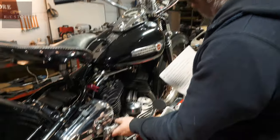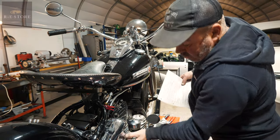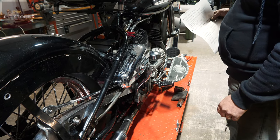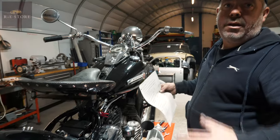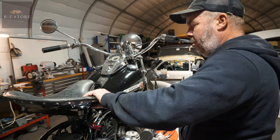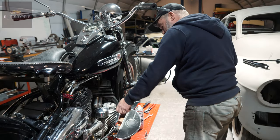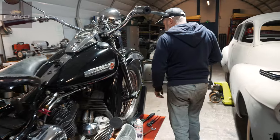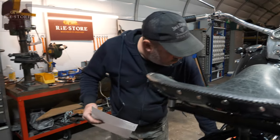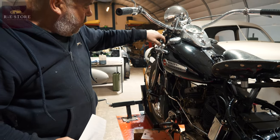It's got the wrong kickstart pedal, which is loose because it hasn't got a split in there. I could possibly put that on the milling machine and put a slot in it, but it's bits you can change later on if you want to get it perfectly original. Seat post bush is gone — a couple of dollars, a couple of euros. The brake bush is gone. Basically any moving part on it where you ride them a lot is worn out, which is understandable for something that old.